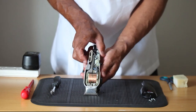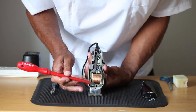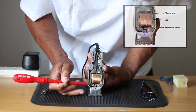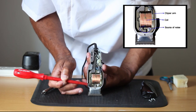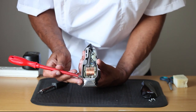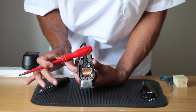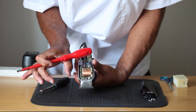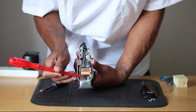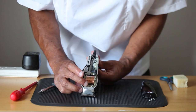Just to show you where this noise is actually coming from: running here around this coil is what they call the clip arm. What happens is the clip arm vibrates, which causes the blades to vibrate and actually cut the hair. Now because it's 50 Hertz instead of 60 Hertz, these arms are moving much slower than they should, and as a result they bang one another. That's where that terrible noise is coming from — these two plates here are banging.